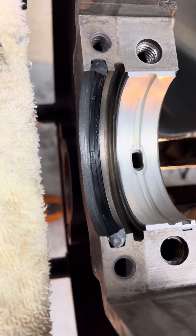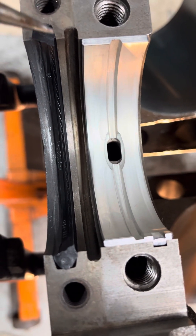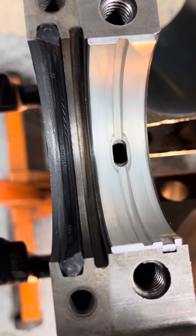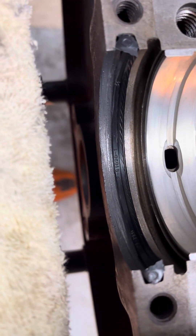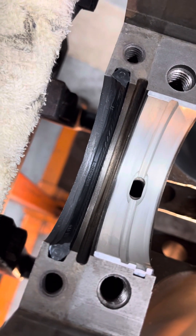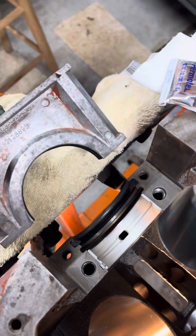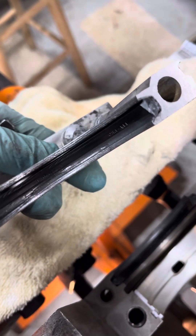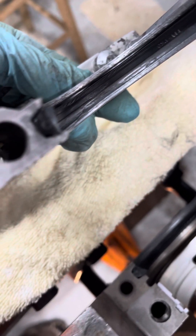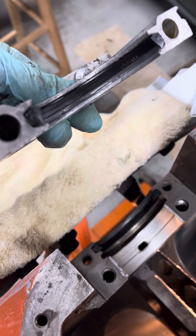You can put those in dry, but what I chose to do was put a little bit of sealant on the back side. The whole front half is dry — rubber seal against metal. I put a small amount of RTV in there before I pop the seal in, then wiped it with my finger just to make sure it's clean, so any oil that gets past there hits a little bit of RTV. Then there's this cap that goes over the rear main seal. This orange side is the outside; this cleaner side is the inside. This is an original one. The seal pops right in, and I've got a little bit of RTV running around what would be the back side.